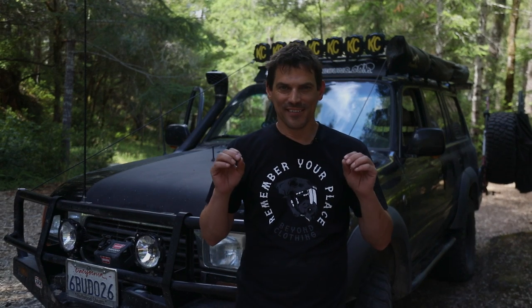All right, now that was a little bit of a setup. The point there is, if there is zero service like this, you're not going to get a signal with a cell booster. There has to be some trace signal in order for that signal to be boosted. And the best case scenario that I've experienced is going from zero reception to LTE. That blew my mind, but clearly there was a signal. My phone antenna wasn't able to pick it up, and the booster really helped.